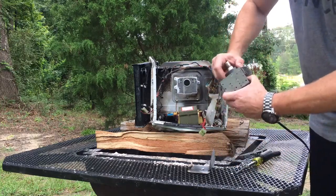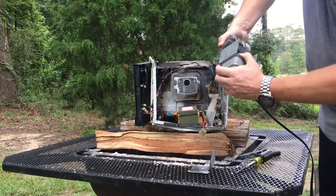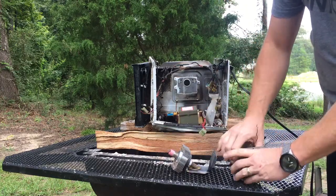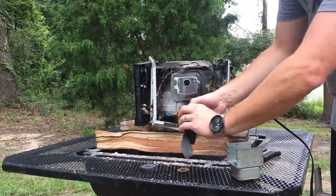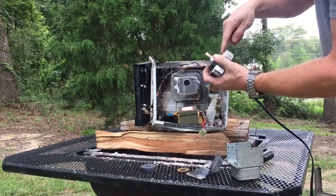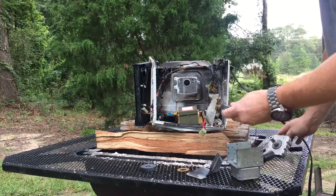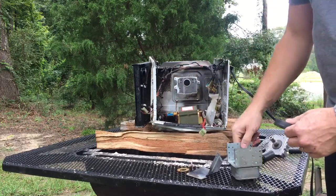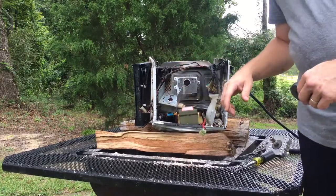There's your magnet. There are the filaments down there — break those little filaments and pull that magnet off. There are also small magnets inside. Since this is a small microwave, the magnets are smaller of course. Be careful not to break the magnet — get that ring off and there are your two magnets. That's pretty much all I'm going to salvage. I don't care about the high voltage transformer or the other parts — the rest goes in the garbage. Thanks guys, subscribe and like!